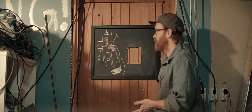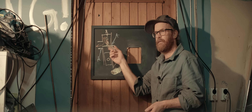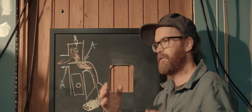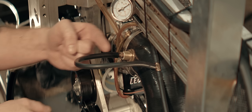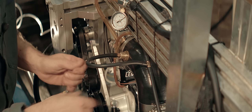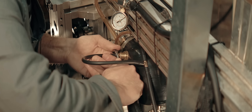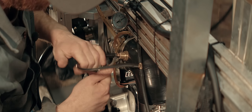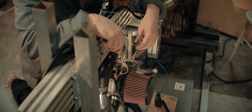I'm mentioning this because on my way to pick up fuel, I got a sudden rush of different ideas to make this even more efficient — I think we're going somewhere else with this. First we'll need to find out how it works without anything else. This line goes to the float bowl vents of the carb and the fuel pressure regulator, and it's hooked up to the pitot tube — a tube pointing toward the flow inside the big pressure tube. I've got a fitting on the other side I can tease off from the pressure tube; I'll mount this to the straight fitting and plug off the pitot tube for now, to see how it behaves. If my theory about the pitot tube being a problem is correct, we'll confirm it; if not, we can reuse it.